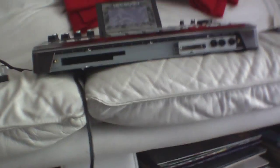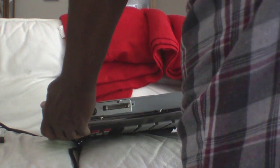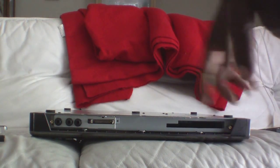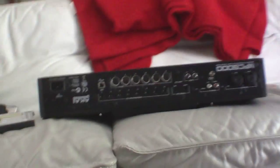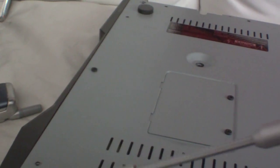I'm just going to set the camera down for a minute. Now we've got the MPC still in view. I'll take it and turn it over — I've already started disassembling it. Turn it over and set it on something soft. There's the front, so you want to turn it to the back. Here's the back of the MPC 5000, and you need to remove all the screws from the bottom because the hard drive is in the bottom of the MPC 5000.